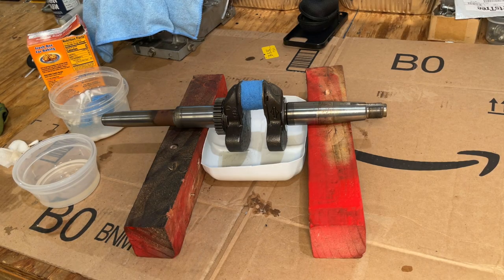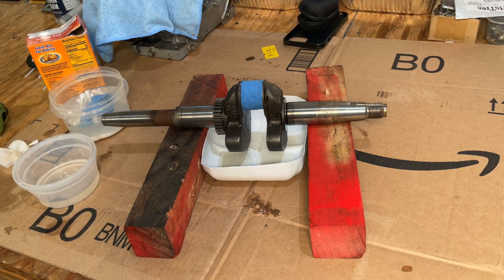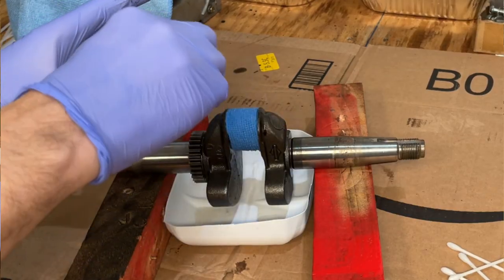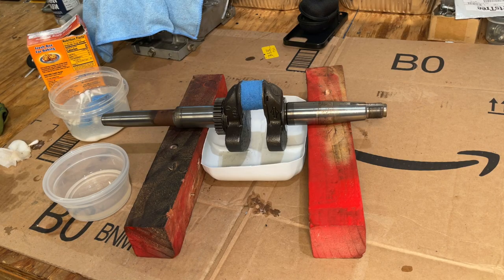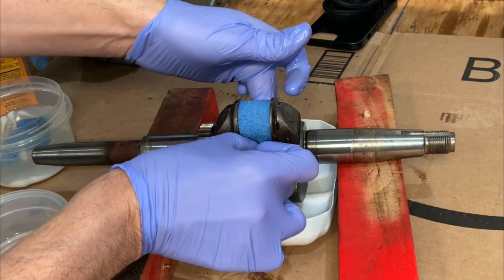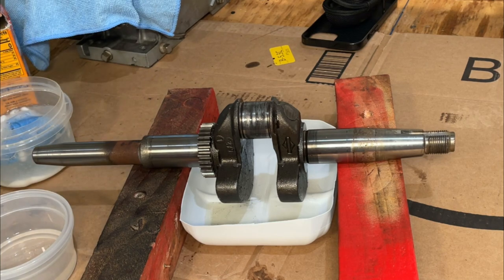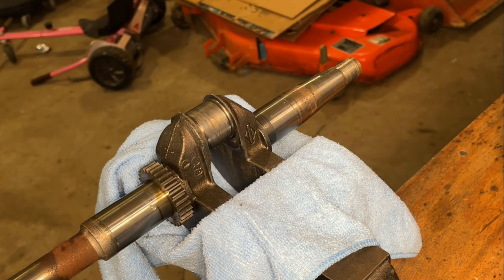So it's been a total of 30 minutes. Every 10 minutes I change that out, check on how things are going, and during each 10-minute interval, I do have to apply a little bit more acid just to keep it fresh and active. Anyway, I think we're probably done now. I'm just going to get that off and see how it looks. Okay, so I'm just going to clean the rest of this up, starting with some 800 grit, and then 1500 and 3000.